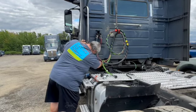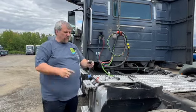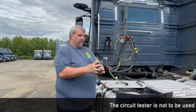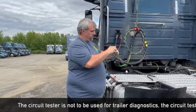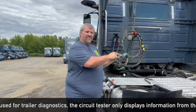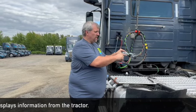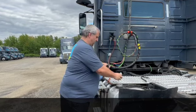Before we talk about the electrical cord, something else you'll see is people try to put this end into the trailer and then plug this in. They see all green and think the trailer must be okay — but all this tells you about is the power supply. The tractor provides the power; the trailer has no power. So if these are all green and it's plugged in like this, it is telling you nothing about the trailer. So don't do that.